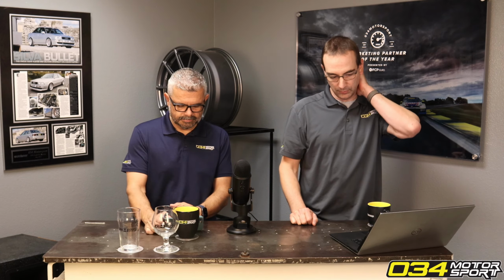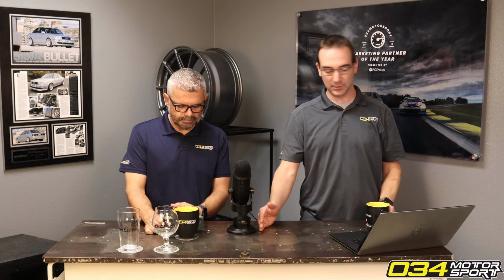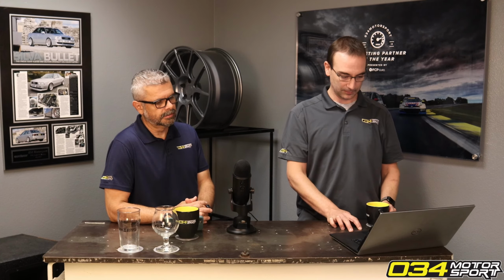Yeah, and it just comes back to it's oftentimes a very difficult thing to prove one way or the other, where we've got thousands of examples that are flawless without an issue, and there's one outlier. I mean, it's not that hard to prove, though. We're looking for things like the evidence of detonation. So melted spark plugs, melted pistons, melted ringlands.